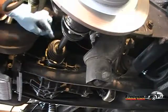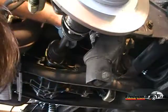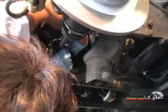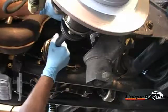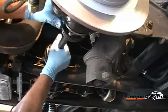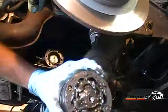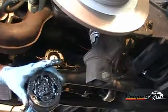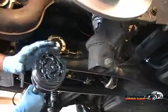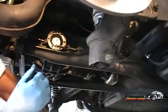The first move is to go ahead and remove the axle. I've loosened up these bolts already — I just have to unscrew these two and remove the axle so we can see the flange. Now we're changing that flange seal. You have to be careful when you take the axle out because the axle has balls inside. If we move it into a wrong position, the balls could come out and it's really hard to put that back together. Just make sure everything is set right and lay the axle all the way down.